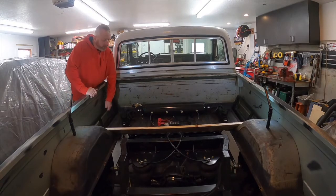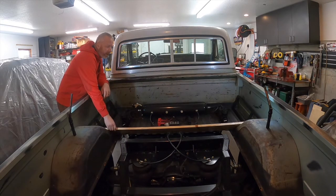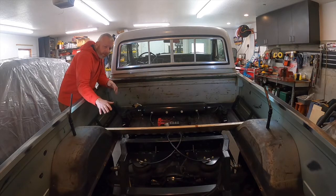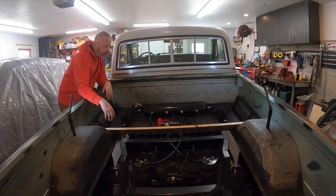This is where I'm at right now. I've got all the pieces painted, and the wood is on its second coat of polyurethane. Got a couple coats on this piece, and it's going to be out of the sunlight, so I think two coats is fine here. I'm going to try to put three coats on the top, maybe four. I'll see what the third coat looks like, but that'll take a couple more days because it's cold here, and it takes a little bit longer to dry. I've got the garage heated, but it's still a little gummy. I'm supposed to be able to sand it after 4 or 5 hours, but I've let it go 7 or 8, and there are still some areas where it's thick and gummy, so it won't sand. So I'm just letting it dry overnight, getting one coat on each day.